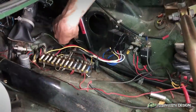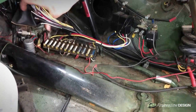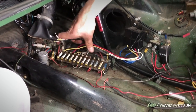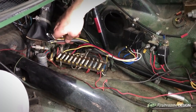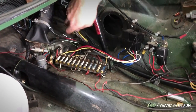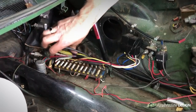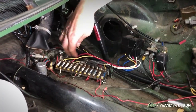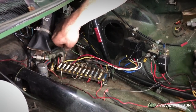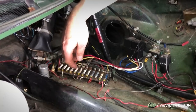We've run our harness all the way to the fuse panel and we have these three leads remaining. Our next task will be to connect them to the appropriate posts on the fuse panel using our schematic. These three wires will be connected off the panel — two to the WECO connectors and one over here to the brown-white — and then three wires to the fuel gauge.